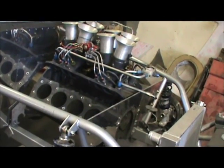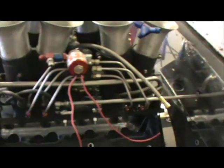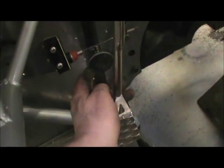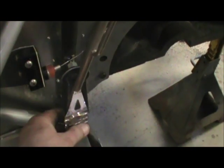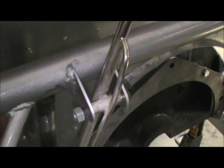I've got the dummy plastic engine in there and I put that intake manifold on so that I can build a throttle stop and gas pedal stop. I've got the throttle linkage in there, and I'm hoping that's in the right spot — I just looked down the distributor hole to get it positioned right. I've got the gas pedal stop here and it's adjustable. I used a threaded insert, drilled a hole in the tube, and welded it in. It's got a locking nut I can lock it down with — just welded a washer to a bolt. I can adjust it up top to where I want it, and then adjust the stop down so the throttle will only go so far.